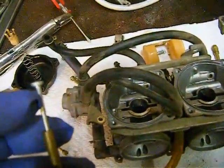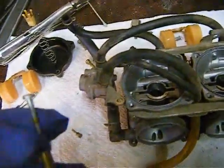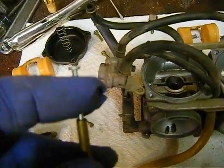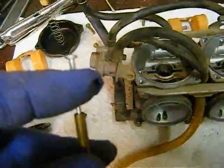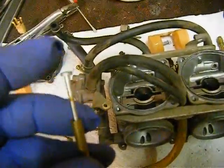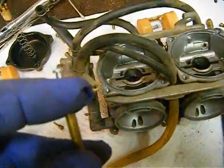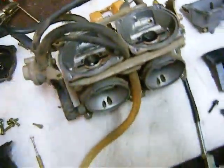What I'm going to do is put a slightly tiny little washer underneath there. I'm going to take this down to the Ace and find the washer to fit, and it's going to pull that needle out just a little bit more — fatten it up a little bit and see what happens. I bet that cures a lot of that hiccup.